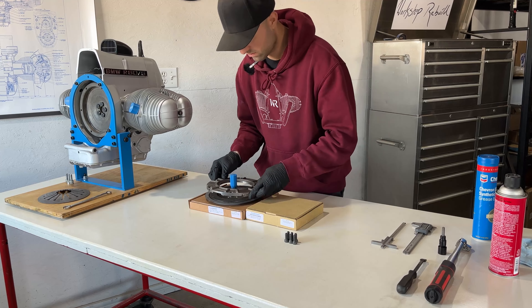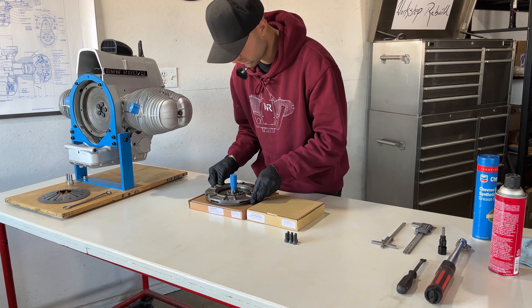To start the assembly, I'll wipe the fiber disc ensuring no high spots. Placing the bottom end of the clutch disc onto the pressure plate, I'll use a 3D printed clutch alignment tool to align it to the pressure plate's center. Then I'll position the front cover downwards, aligning the holes with the pressure plate.